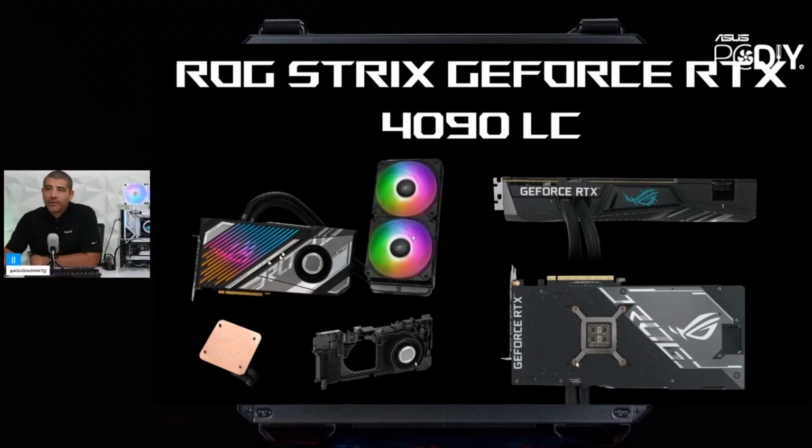You pick whichever mode you prefer, and you can always also go into the software and fully customize the fan curve yourself. And speaking of fan curves, this card does still also maintain the Fan Connect 2 headers that we see on the ROG Strix series graphics cards. So if you want to connect additional fans to the rear of the card to have additional control flexibility for temperature input mapping for, let's say, front intake fans, you can do that. So you could connect 2 fans in the front of your chassis to the graphics card, go into the software and say you want those fans to respond to the GPU temperature and not the CPU temperature, and those fans will actually ramp up and respond to the GPU temperature. So that is what we call our Fan Connect 2 header design, and you'll find that on the ROG Strix series graphics cards.